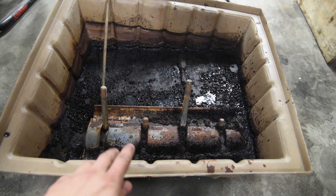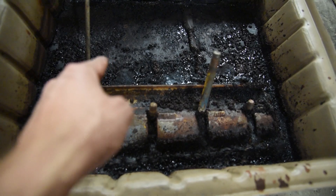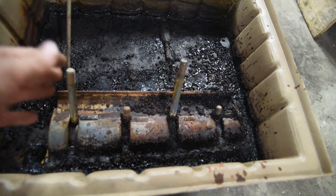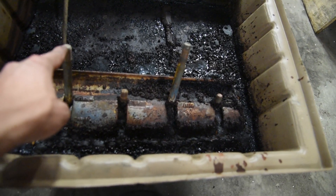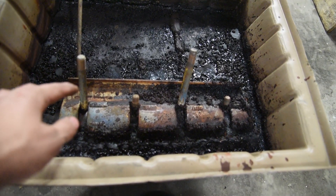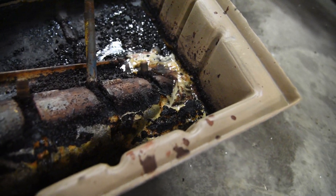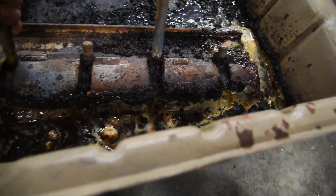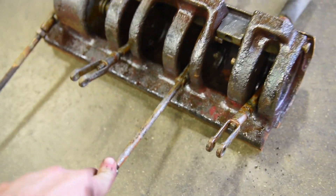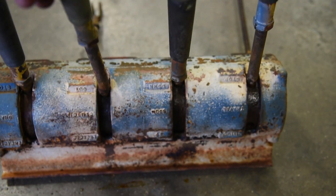I've been soaking these control levers for a while. Believe it or not this started out as white vinegar — it's got all the nasty dirt, grime, and grease clumping up around the surface in an almost crust over the entire bucket. I let it soak for a few weeks, pulled it out, and started hitting these with a hammer back and forth. A lot of these just needed a little tapping; this one took a lot of force. I knew I wasn't going to be working on the Jeep for another couple of weeks, so I threw this back in so the vinegar could get more of the deeper pockets. Look how disgusting this stuff is — that's what nightmares are made of. With the shifter assembly all cleaned up you can really see how nice it is after soaking in that white vinegar. Soaking it the second time is really the key — look how easy this lever moves now.